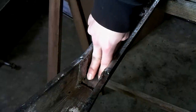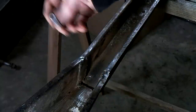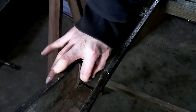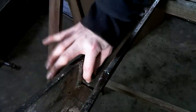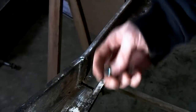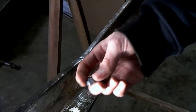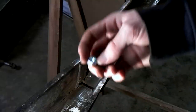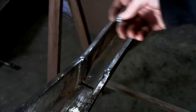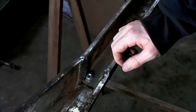Here you can see the two mounting holes for the shock mount. This is the original nut that you had to get in here from the rear, use your wrench and tighten it, but it's very difficult because it's very close to the edge. This is a new nut that I will be welding to the back of the chassis. It's not a nylock nut because if you weld a nylock nut to the chassis, chances are the heat will cause the nylon to melt and seep out. So I'll be using a regular nut welded on the back so you won't have any problems attaching the shock mounts.